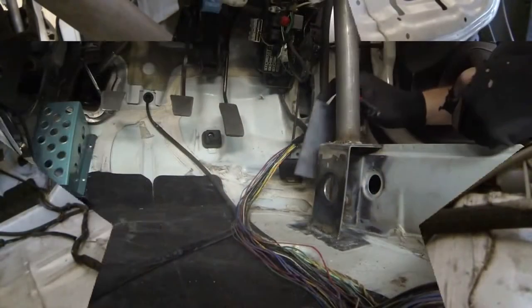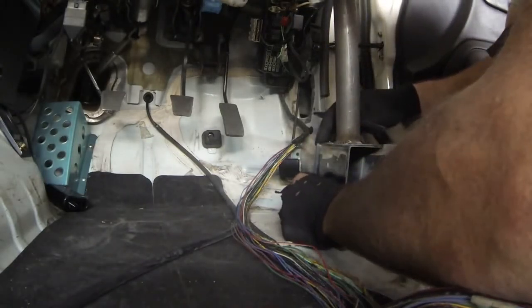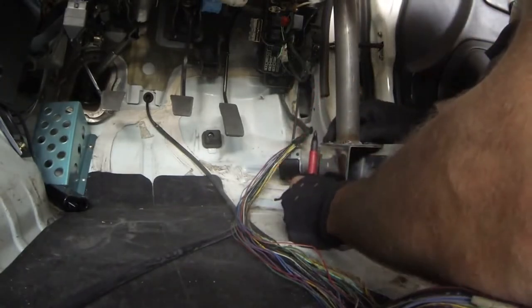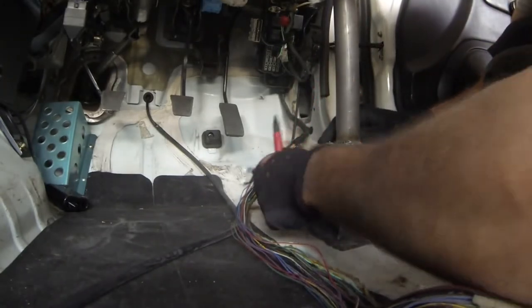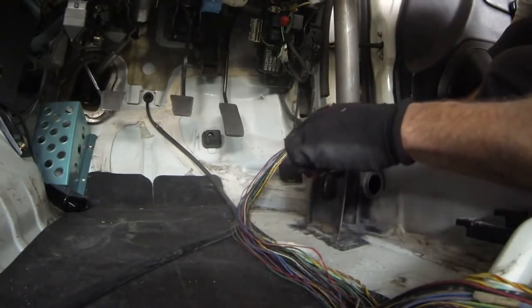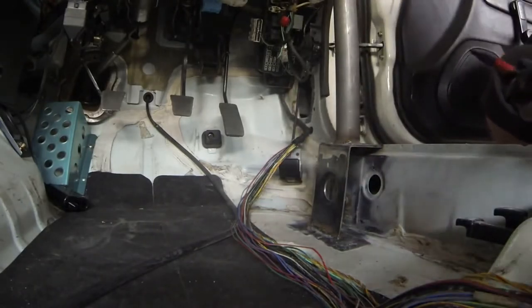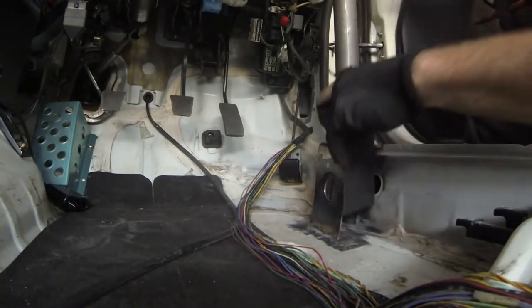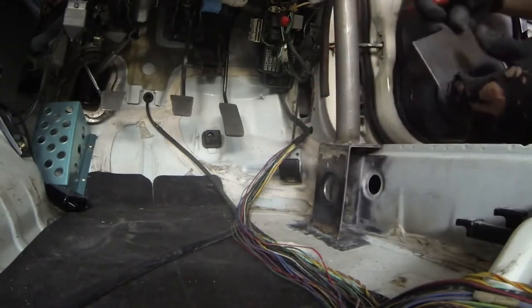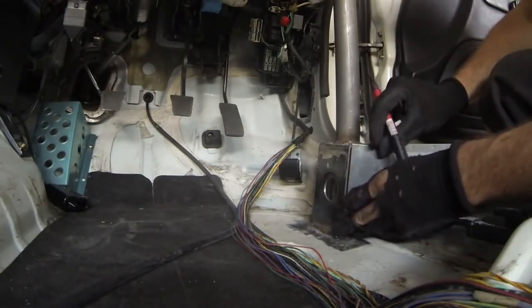Let's move on to the front. These are pre-measured and cut; they sit at about five inches tall, as opposed to four and a half in the rear. Since I can't really get around to the backside to work, I'm just going to trace this line — that'll give me my angle. Now if you'll notice, there's a hole right through the middle of that, and I don't want to fill that in or slug that one, so I'm actually going to kind of go around it.